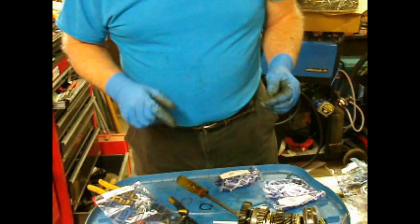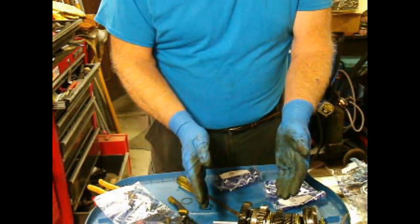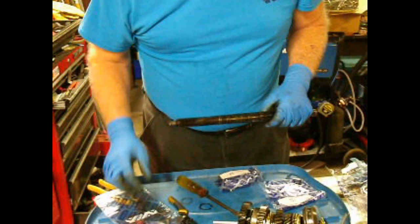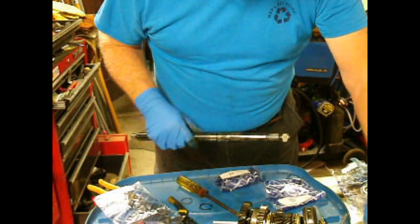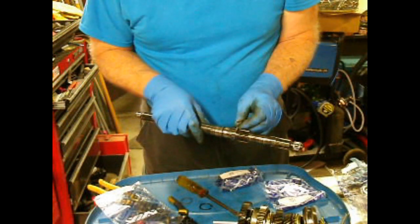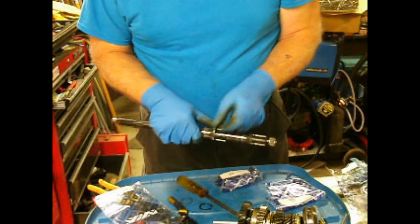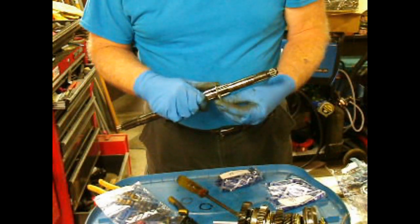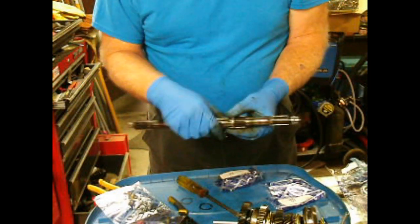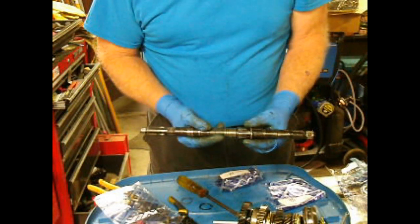Now the next thing to do is assemble the main gear set onto the input shaft. So it feeds from two directions. If you remember, there's the two-piece snap ring. That's this, and that goes into this notch. And it's the concavity of this gear set that holds it in place. These gears that go on this end just push up to it loose.